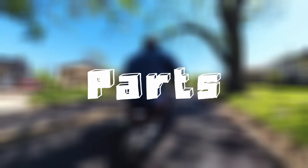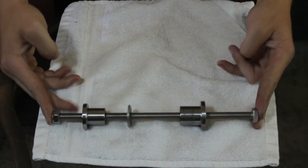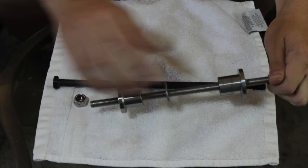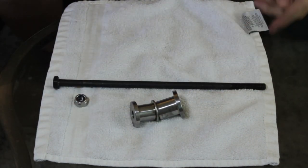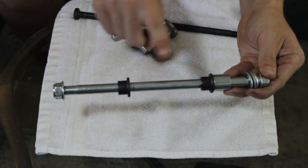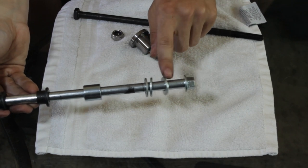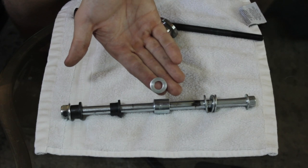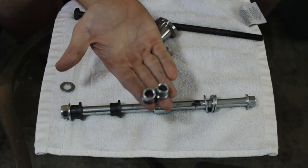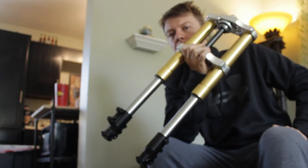Let's go over some of the parts you'll need. You'll need the Ride or Die bushing kit — all of this will be in the description below. You'll also need a longer 280 millimeter head tube bolt; the Ride or Die bushing kit comes with a bolt but it was too short in my experience, your mileage may vary. You'll need a longer axle, the stock spacers that come on the bike, the spacer that comes with the axle, a few washers that come with the axle, a 10 millimeter washer, and the two stock bushings that come on the head tube bolt with your bike. And of course you'll need the forks themselves.